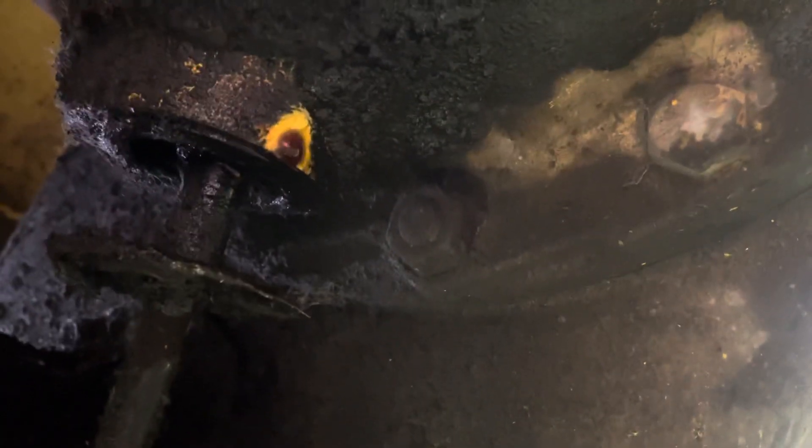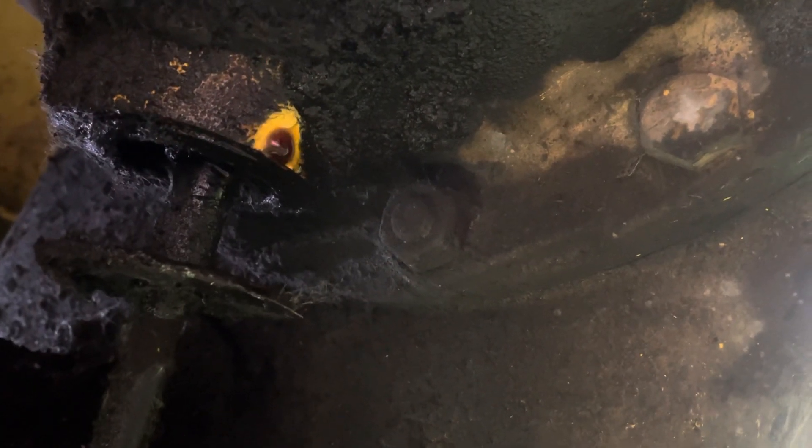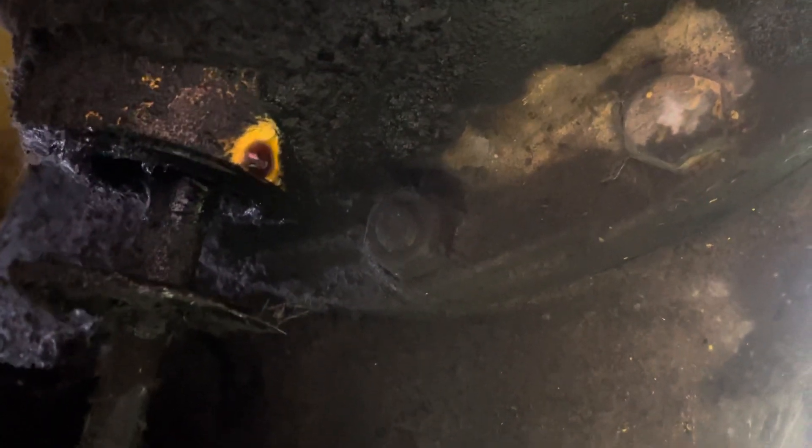I'm going to lift the side cover up. You can see this is leaking oil out — you can just change that boot. There's no dipstick on mine. I stuck something down. The fill plug is on top of the box, and there was no oil in it, so I filled it with oil. The fill plug is just up top of the rear.